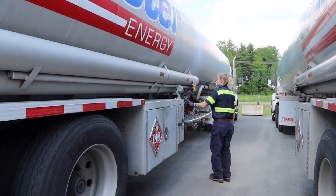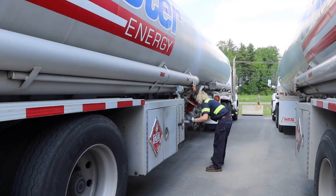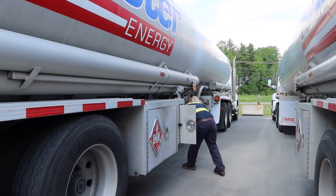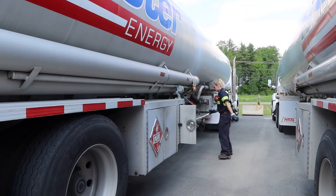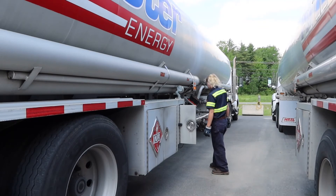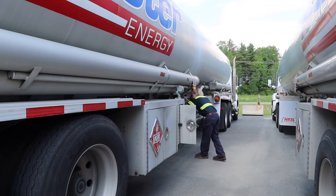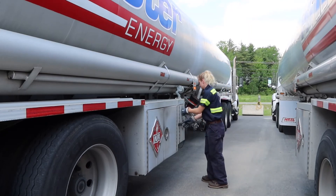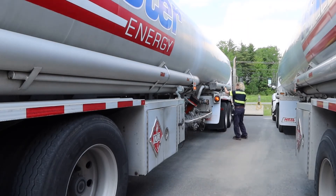Moving down this side I make sure my boxes are secure, check the placards, verify the work lights are good, all tubes are secure, nothing's wearing, and the straps are in good shape. Then I check my manifold — I open each compartment and we have sight glasses on the side of the trailer so I can verify no liquid is running into the sight glass, confirming nothing is on the trailer in case something was missed. I always check that before I load. Then I close the manifolds and internal valves, shut the side door, and make sure I have cones, caps secured, side doors secured, and lights working.